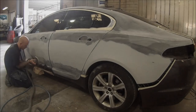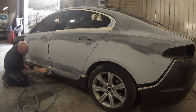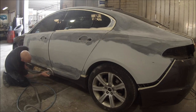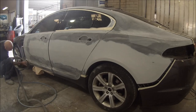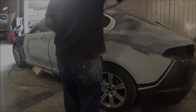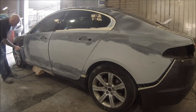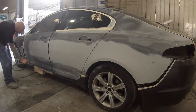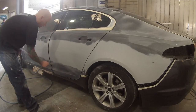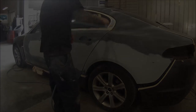Doing dry sanding, one thing I've found you have to be careful of is with a fresh piece of sandpaper doing the blends — it's not so bad because I've got the dust extraction — but if you go and sand over the primed area and then with that dirty piece of sandpaper rub over the blends, the dust from the primed areas will actually end up on the blend area, and you can end up with like a milky haze of that primer over your blend area which is only clearing. So you've got to be careful of that one.